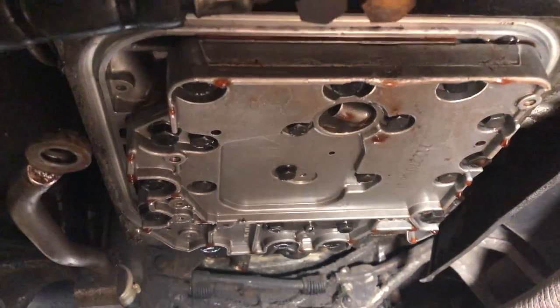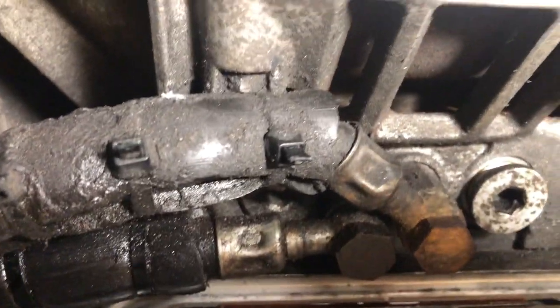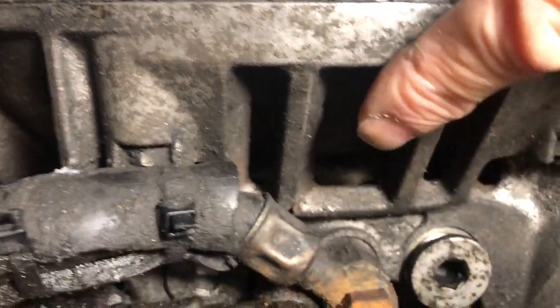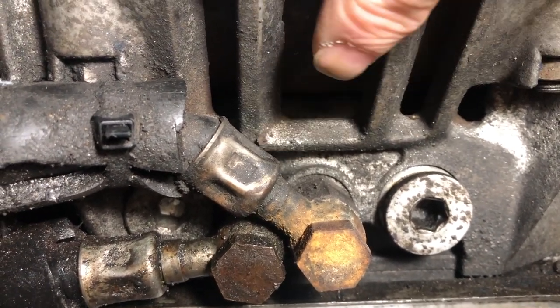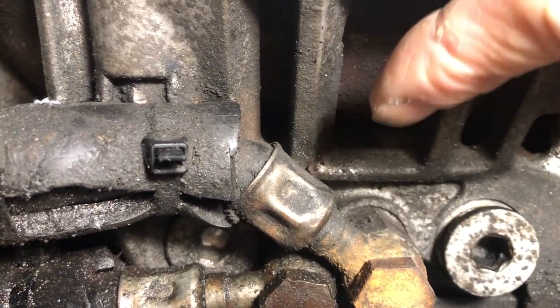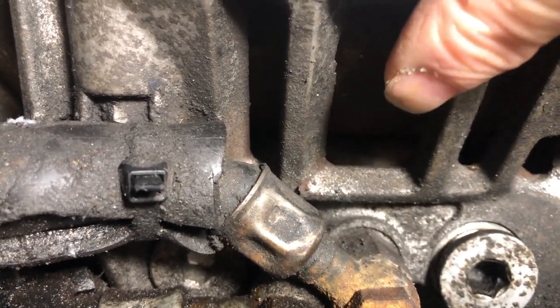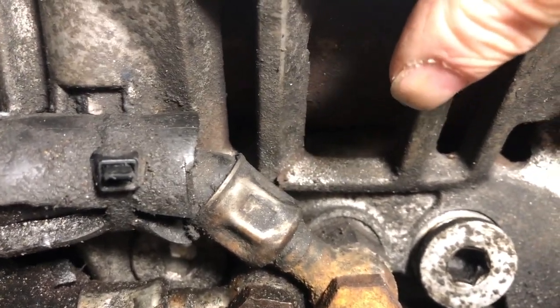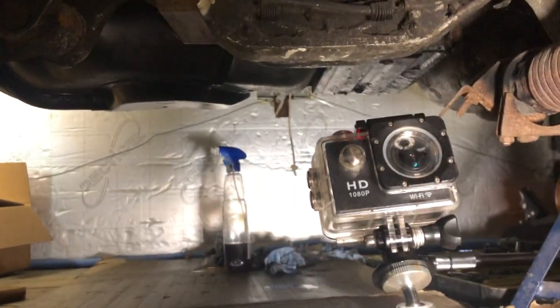The gearbox has drained quite nicely. This is what it looks like with the pan off, and I've taken the filter out as well. Now what I need to do is drain the torque converter. I'm going to be looking in this window and rotating the crank until I can see the drain plug. From a factory car, when you put it at TDC the drain plug is visible here — but as mine's been spun around a few times it doesn't line up. What I need to do is turn the crank until the drain plug is visible. I can't do that easily unless I cheat and put a little GoPro underneath — so that's what I'm doing now.